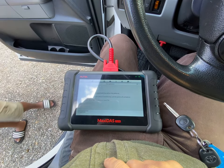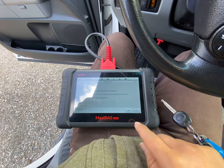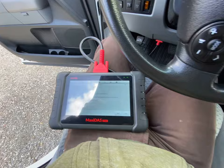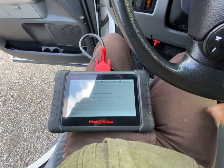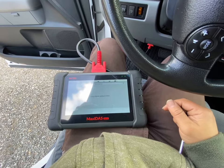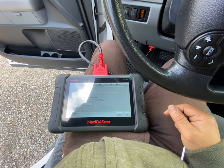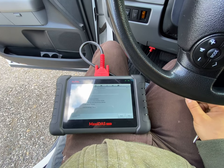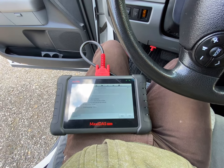Let's sit on the other side. Insert the retro master key and hit next. Remove the key from the cylinder — insert the key into the cylinder and turn the ignition on.